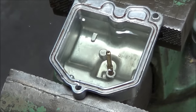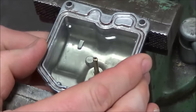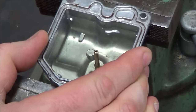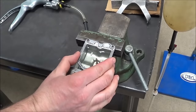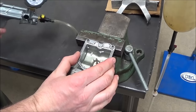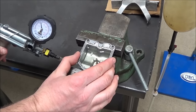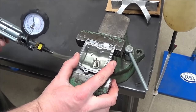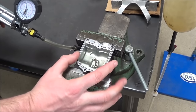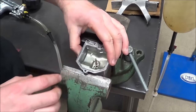So what we've got to figure out is why do we keep getting this little drip here? A lot of these bikes, as they sit for long periods of time, get water in them. And if you back the camera up here, you're going to see what I have is a MightyVac with a hose attached to it on pressure. I'm going to go ahead and pressurize the bowl here. You're going to see we're getting leaks without even trying too hard, without even plugging it.